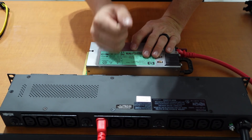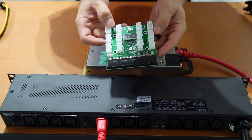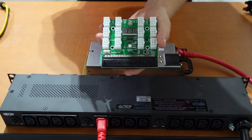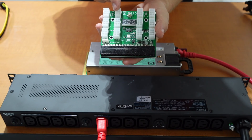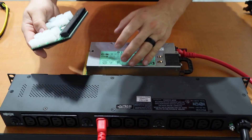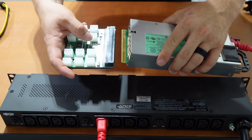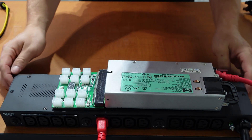Power flows from the red cable into the HP power supply. Our next step is to go directly into a breakout board. The breakout board has a number of PCI slots that can power GPUs, GPU risers, and in some cases like the RevTech motherboard, it can power the motherboard too. It has a power button as well. The breakout board has a female end and we have our male end, so we interface them together.